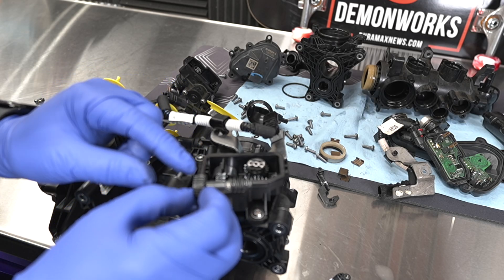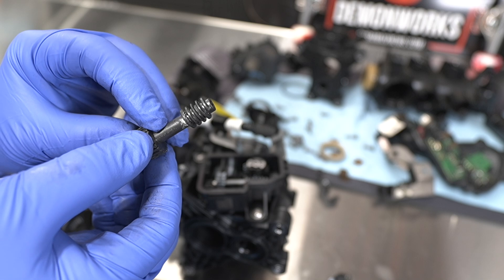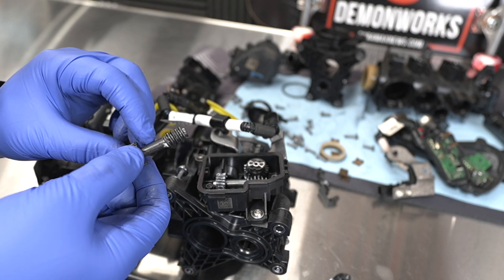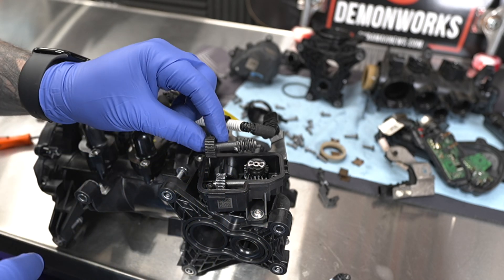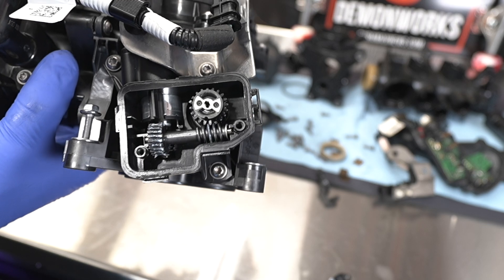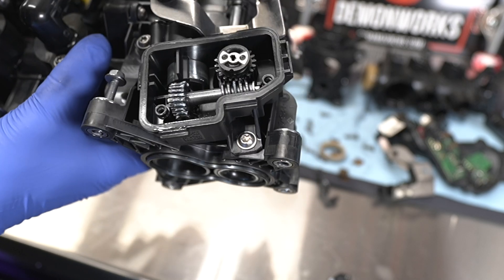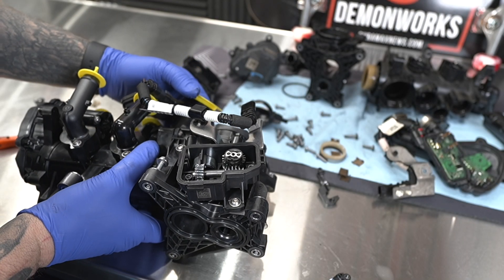Pretty much what I'd assume is once the grease starts to go away, you can see the buildup inside this worm gear — and that's riding on another plastic worm gear. So you have plastic on plastic. Whether or not metal on metal would be better — I would think so, but I'm not going to pull that one out because we can already see inside. We know the fail point. We can see that they do include grease, but just a very little amount. Maybe it needs a little bit more. If you get a new one, you might want to put some more grease in there — I kind of think that might be a good idea, but I'm not going to be certain.